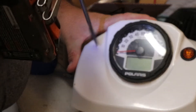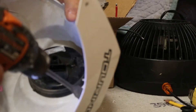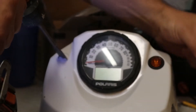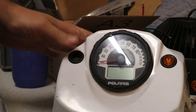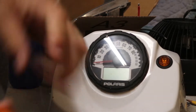Be real gentle here. One thing I do like to do is, if possible, hit it from the reverse side so we don't get as many burrs on the inside. It's not as bad as plastic, but we want to make sure we get the grommet to sit in the groove without the burrs. We're going to pop it in, and then once we lock the LED in, it'll stay. This particular model has a little bit of a groove here, so we're putting these up and down.